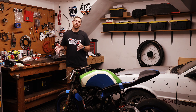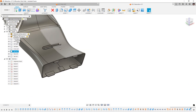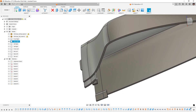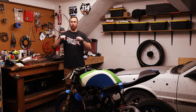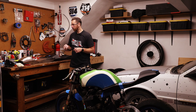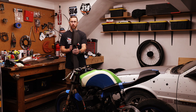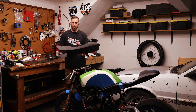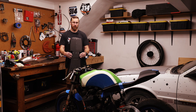Once it's a solid with all the little details added, we'll slice it up into different pieces and add fasteners or overlapping sections that we can glue together. I'll give a shout-out to Z's Garage — he was doing a CB build and built a fairing using a soldering iron or plastic welder with little metal brackets pressed into the plastic. That's a great way to hold 3D printed parts together, and I really wanted to do it on this build. But because the tail section is solid, there's no way to do that without the pieces being on the outside, which I didn't want. So unfortunately I went with the epoxy route — it's not perfect, it's a bit messy, but for this concept it worked.